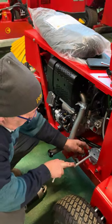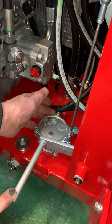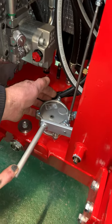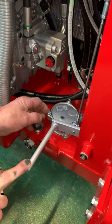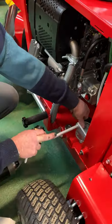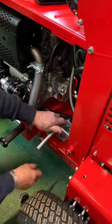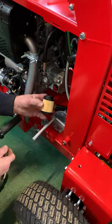To change your hydraulic filter, remove the three number 10 studs — always be careful not to over tighten them when replacing, as it's an aluminium housing. Once removed, hold your fingers down on it, then twist and lift it off.